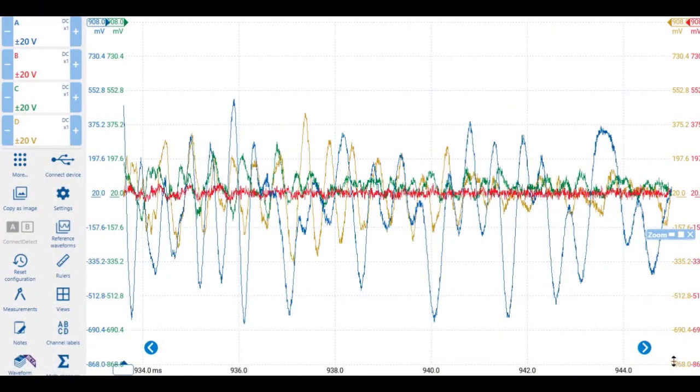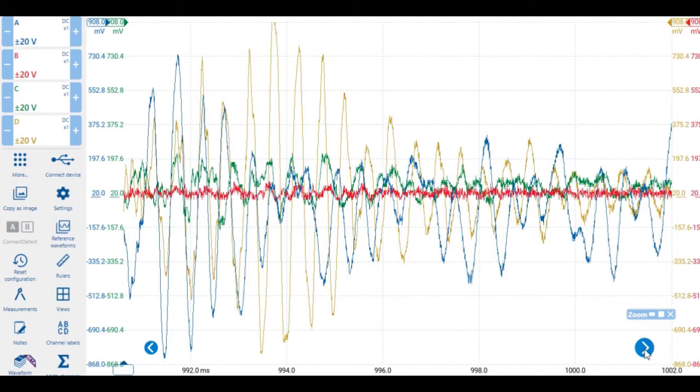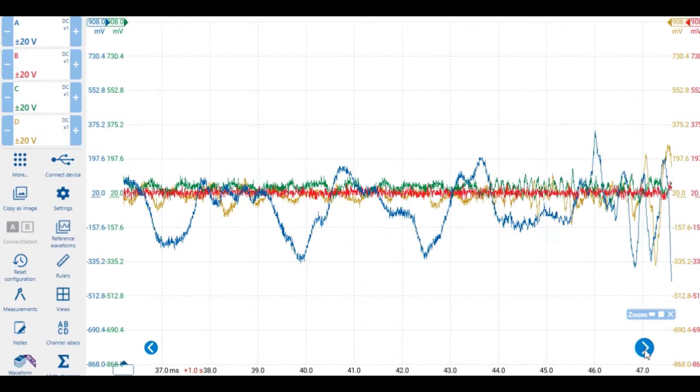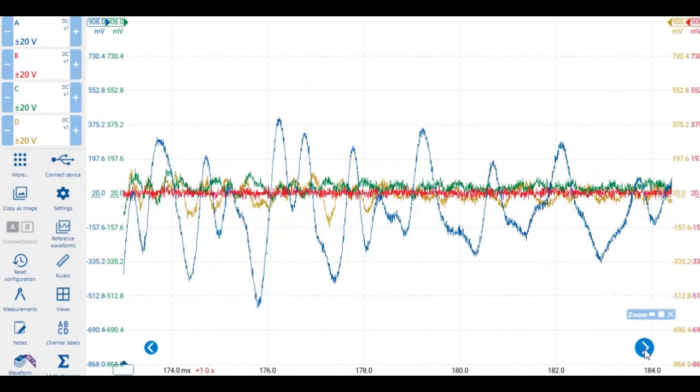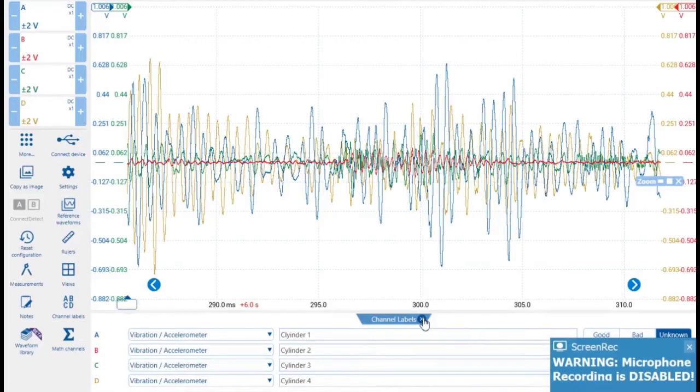So if you notice, I'm getting a large spike on the blue — number one cylinder injector. It sounds like a lot of noise coming from there. I got it hooked up to various parts of the engine bay. I got the blue one right now hooked up to the front area of the engine by the belt. And you can see that the pulse in the waveform is very large and it's standing out no matter what I'm doing, scrolling through. So that kind of helped me narrow down where the excessive noise is coming from.